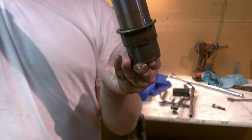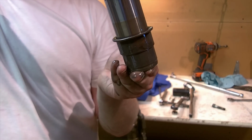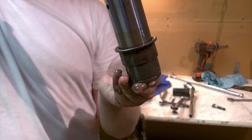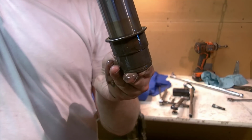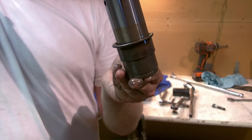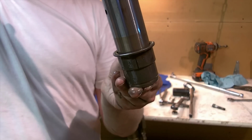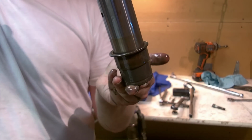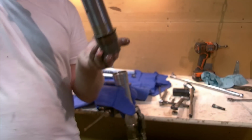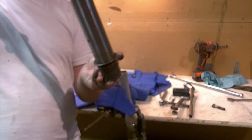They are something you have to order through Yamaha, which is the hang-up for most people if you're waiting on parts. They are about $8 a piece, so there's 4 of them, so it's $32 more to your fork job. But it's cheap insurance. If you're in here, it's time to do it. This particular bike has 44,000 miles on it. This is its second set of seals. I'm definitely replacing my bushings, my O-rings, anything that's consumable this time around. First time around, and you've got a lower mileage bike, and you visually inspect them, and they inspect good, you're probably okay to go for a while.